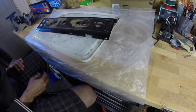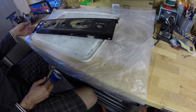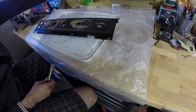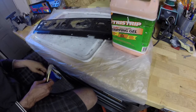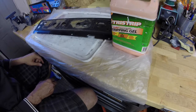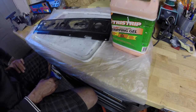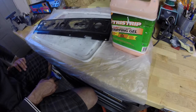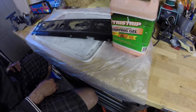That was just a quick pass with the chisel to get through the super loose stuff. What I found works pretty well — a year or two ago I stripped woodwork in one of my bedrooms using citrus strip, which is nice because you don't get gassed out. For stripping metals I've had great luck with it on my Tron control panel and the Donkey Kong coin door. It's really low effort — you just kind of stack it up, get it bunched into the corners, and let it do its thing. I'm going to layer this on and then cut back to what it looks like when it's done.